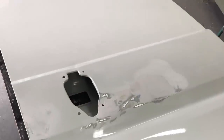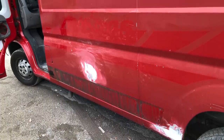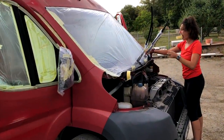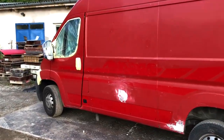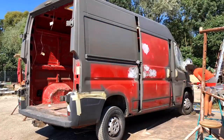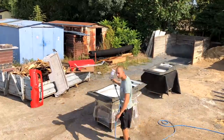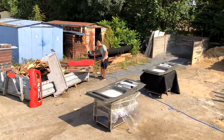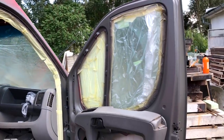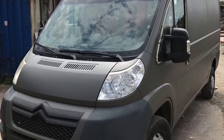Next is the paint job. First I did some body filler to fix imperfections. Second, I ran around the car with fine sandpaper and sanded down loose paint and rust. Third, I washed and degreased the entire surface. I decided to just roll the paint on the van — it's the cheapest and fastest way. I spray painted all curves first so there are no brush strokes, then did two coats. The result is pretty good, and if I scratch it I can just do another coat for a few dollars.